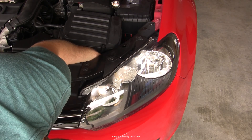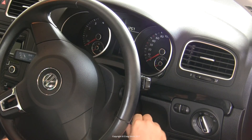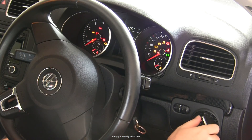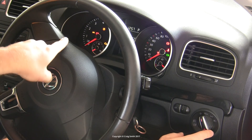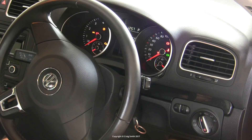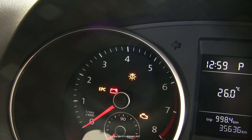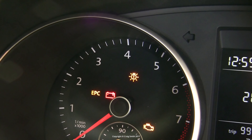And after that you are done with the physical work. Next up you will probably find — either during your testing or after cycling the ignition — that the car has set a bulb-out error on the dash. This is because the LEDs are way lower powered than the incandescents, and the car just doesn't see them, so it thinks that they are blown.